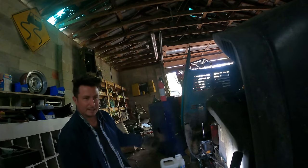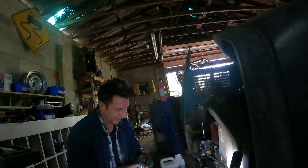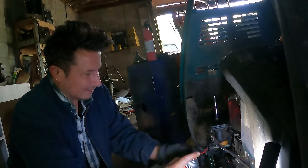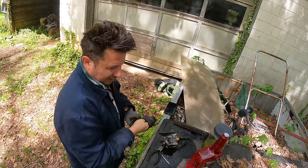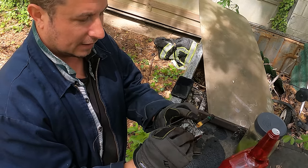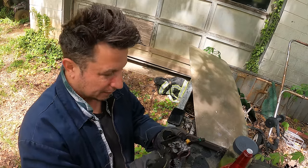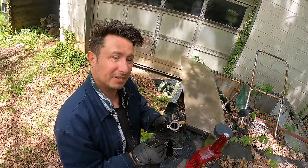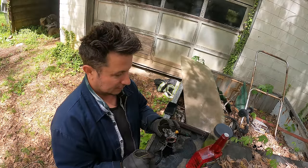If you haven't noticed, we're working on the Murphy's Law approach here, gang. I thought: if I moved everything out and dragged this thing to the end of the garage where there's light and space, she'd never work, and then I'd have to drag her back. So I'm hoping by not doing that I'm encouraging the universe to help me out. That's not sending any juice through. Gang, I don't know the extent of our problems, but the needle has seized itself inside the carburetor. So if we can break that free, then we can find the next problem. I feel like we're sunk here. I've tried blowing through it, tried filling it with Marvel Mystery Oil, and she's jammed in there.